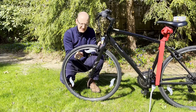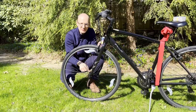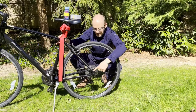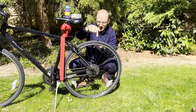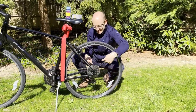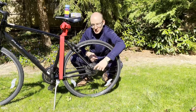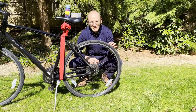The third is that these spokes — I said they were radial, but they're actually not, are they? They kind of go slightly off-centre when they come to the hub. So let's go to the very back of the bike. Here is the reminder of why they're not quite radial: they align tangentially to the hub. Because of course, the whole point of a bicycle isn't just to take our vertical weight down from the centre — it's also to move forward. So as we have this torque that occurs at the hub when we bicycle, we need to transfer that load axially into the spokes. To do that, so that we're not twisting them, the spokes come in tangential to the hub as they go out to the rim.